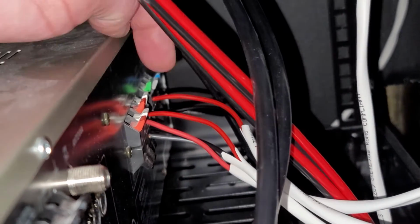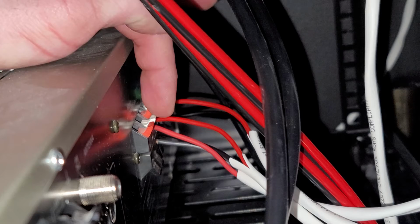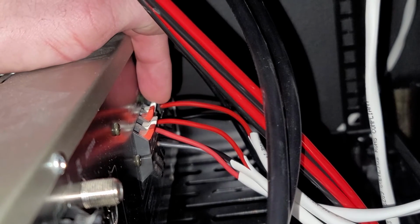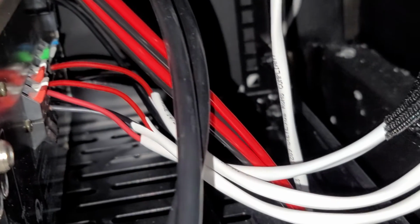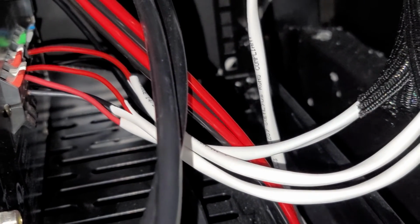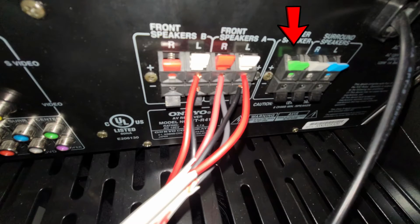I initially attached the 3 speaker cable runs to the left, right, and center channels of this receiver. I figured out that the center channel wasn't getting the same output as the left and right connections, so I moved the center speaker connection to the left connection of speakers B, and that solved the issue, so all 3 channels were getting the same output across the board.